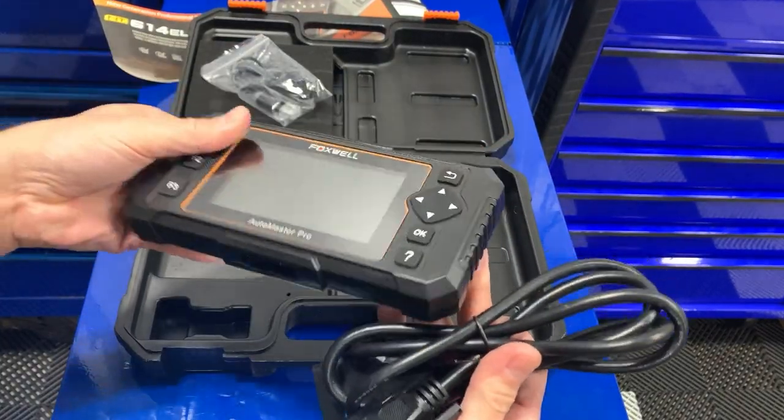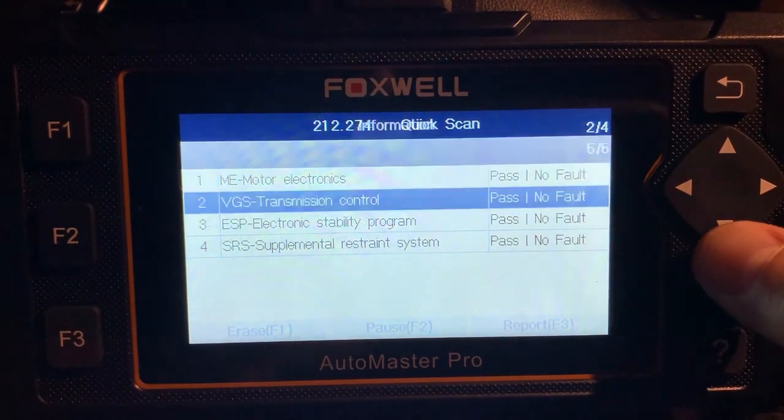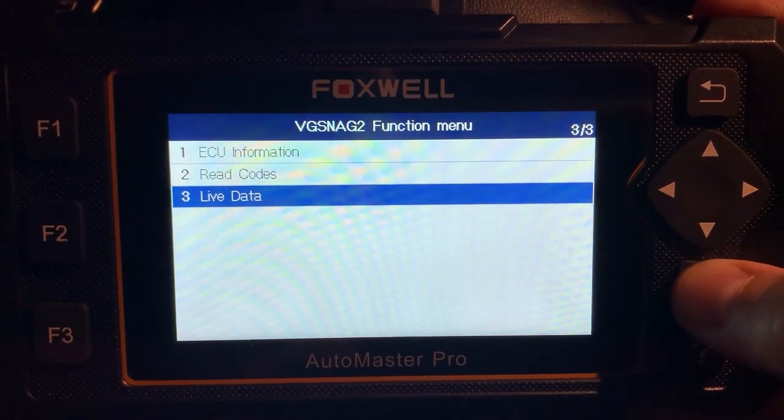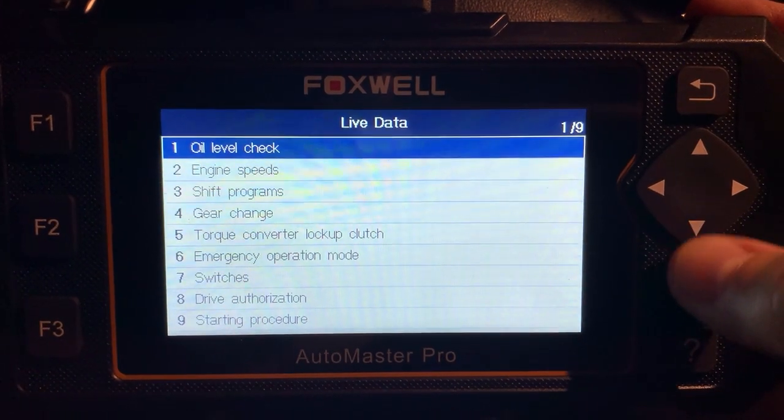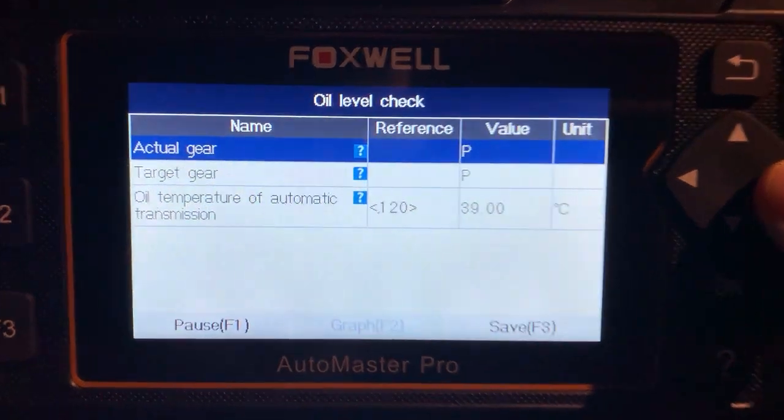Got your cable to the car — very easy. I've been using this for the last few hours on a 2012 Mercedes-Benz E63 AMG wagon. I like it so far. I've been able to read the codes — I don't have any in this car right now — but you can read and clear codes, see live data, and check transmission temperature, which you need to know in newer cars to get the fluid level correct.